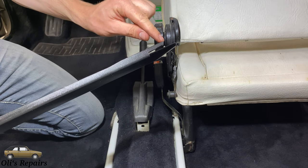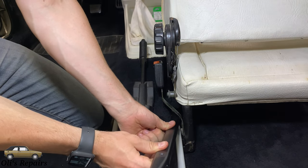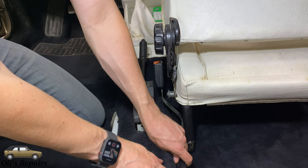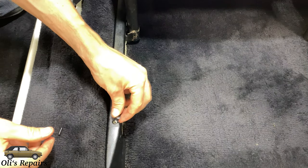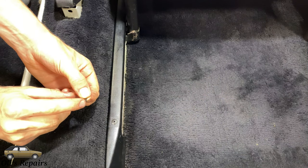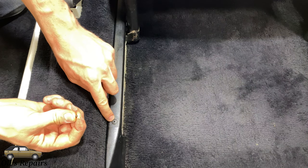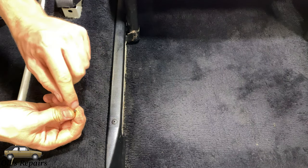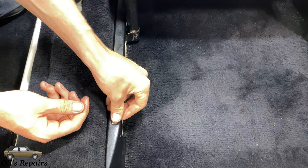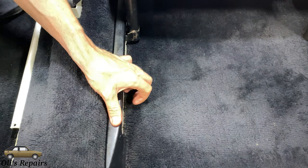To install the seat rail cover, this little piece right here needs to slide right inside of that hole — just slide it in at an angle and then it'll lay perfectly flush. Take this plastic retaining piece and slide it in. On this little plastic piece, there's one end that has a little slit in it and another end that's flat and textured just the same as the cover. Make sure you take that textured end and keep it on the top so that it matches and it's nice and original. Slide it in carefully, and you might need a screwdriver to carefully tap it in.